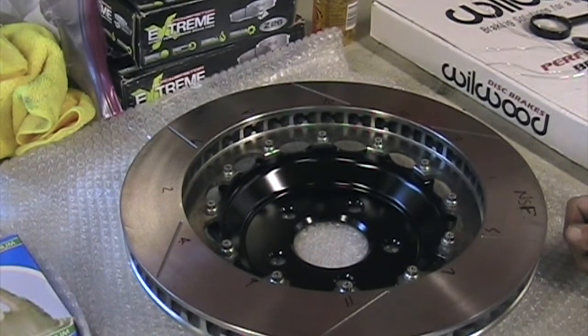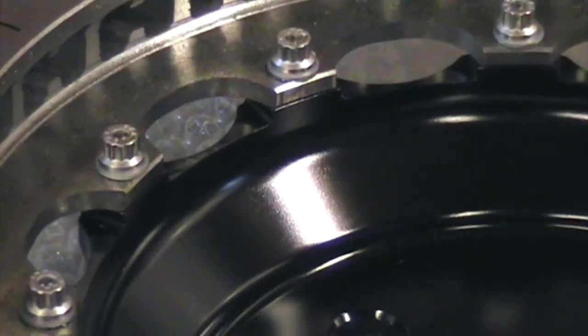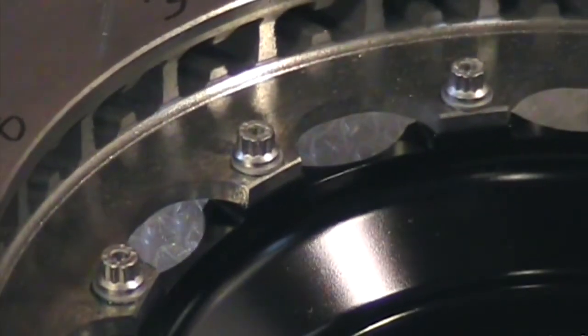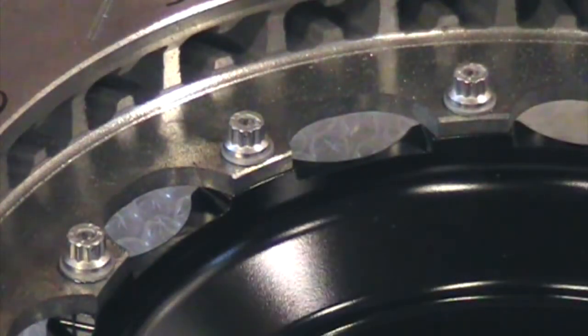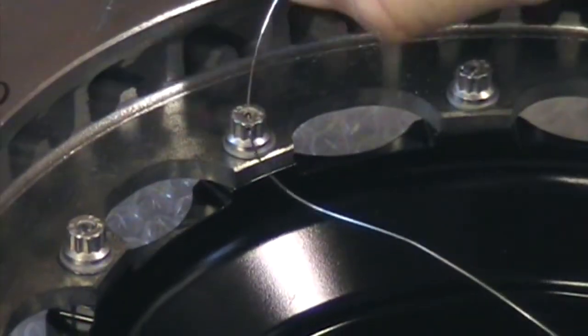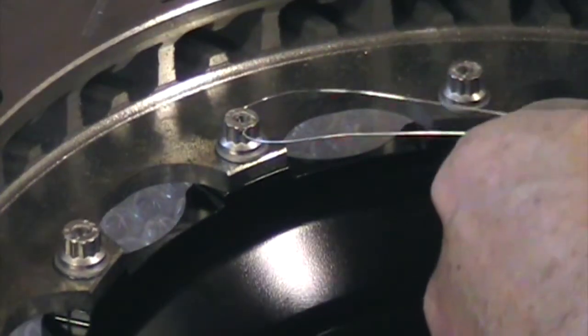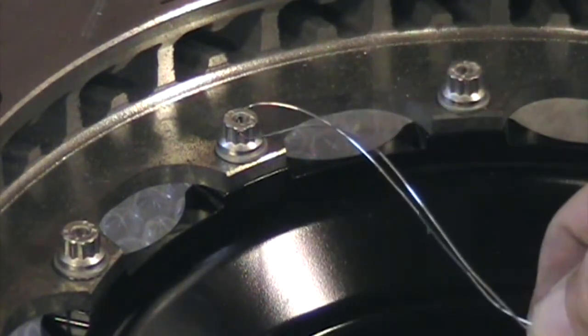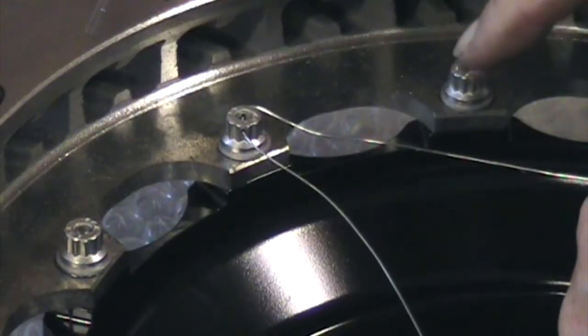Onto the lock wiring. I'm going to zoom in so you can get a good idea of what I'm doing. We'll start off at the top with number one. I've got my piece of wire which is 9 inches long. You have to find one of the holes in the bolt — there, look, it goes through. Then fold it round and get yourself pretty much even. Then we're going to be lock wiring into this bolt here — this piece of wire goes around the back of that bolt.